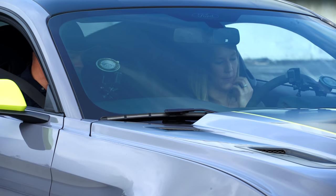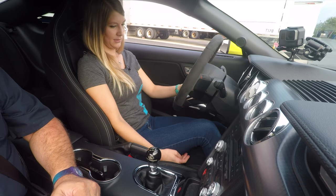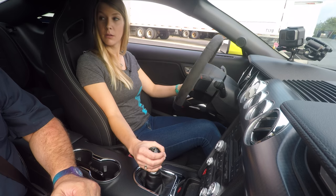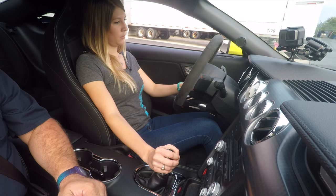Take your foot off the brake — the car shouldn't roll, we're on a flat. Push the clutch in, stay away from the gas, do not touch the gas. Put it in first gear and keep the clutch to the floor, do not let the clutch out. Now let the clutch out until you feel the car — watch the tachometer go down. It'll feel like the car is about to almost shut off. When you reach that point, push the clutch back in. That's the engagement point — where the clutch is now engaged and putting power to the back tires.